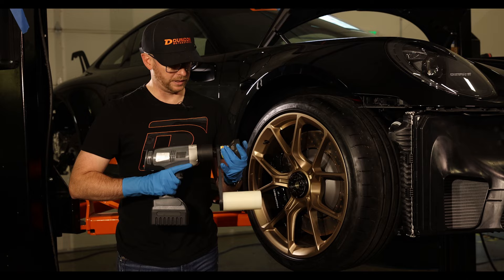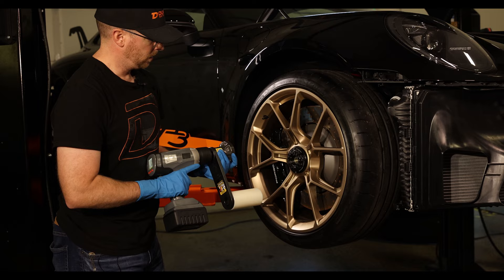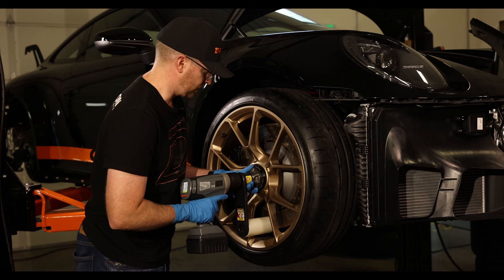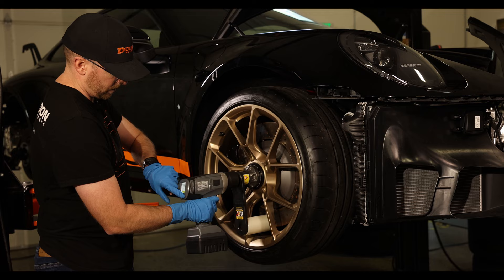Here's the completed tool assembly. You can see the gun is on, you've got the lever arm, and then the factory Porsche wheel nut tool. We're gonna slide this in - this lever arm sleeve is Delrin, so it's not gonna damage the finish of your wheels. I'm just gonna be very gentle and slide this in. The lug is already loose, got that pressed on there. I'm gonna hold it on, squeeze the button - I've already got it set to tighten to set the torque. Squeeze the trigger button, then just push any button to start the operation.